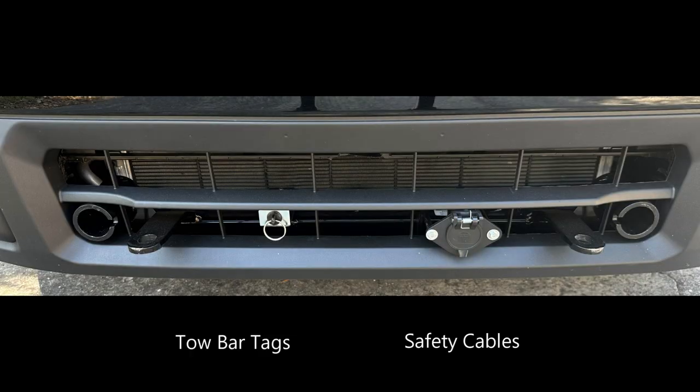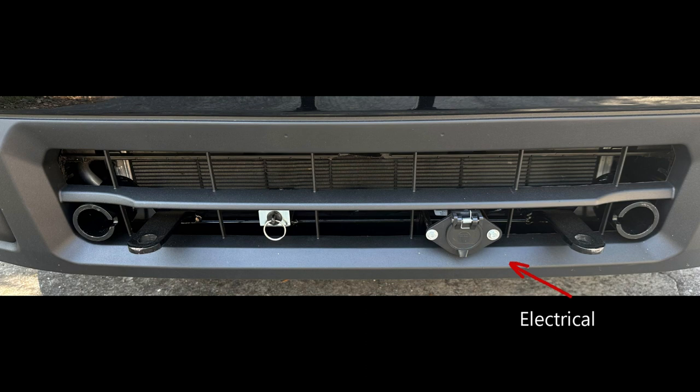The base plate provides a way to attach your coach to the tow and a place to connect safety cables between the two. It is the link for electricity to your taillights and to keep the coach battery charged. If your tow should become detached from the coach, a breakaway system will activate and stop your tow.